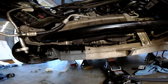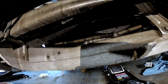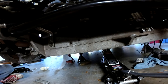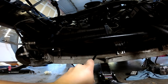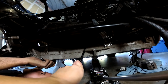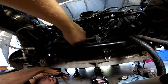There's one important thing, and this is where the repair manual saved my butt — otherwise we would have been in big trouble. There is a wiring harness that runs along the K-member, held in with just a few pins, and we want to pry that out before we lower it. This right here is the appropriate tool — a trim or pin removal tool. It gets underneath these pins and pulls them right out. This tool is super cheap, pick one up if you don't have it. I see other YouTubers using a steak knife, which is a stupid idea. Always use a trim removal tool — the job goes easier, you won't break any clips, and it'll be a cleaner job.